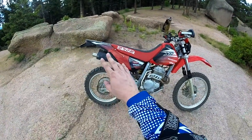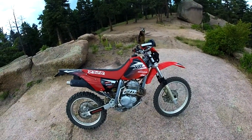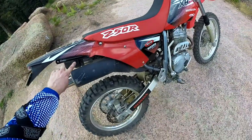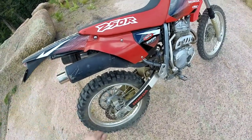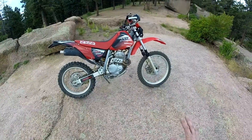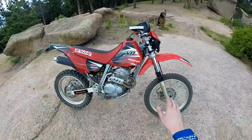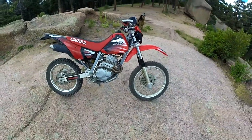I did paint a few parts aside from the side panel. Side panels are temporary, but permanently, this was a gray airbox. I got a black one on Craigslist, got it home, and all the tabs to mount to the frame were actually busted off so I couldn't use it. So I painted that one with Krylon Fusion, and then I used auto paint for the frame right here because the frame was sticking out and was clashing a little bit too much with that black plastic. Those are the only parts I painted. I did an okay job cleaning up the motor - put some degreaser on it, let it sit, went at it with a Scotch-Brite pad really good, and then hosed it down. It's a lot better than it was.